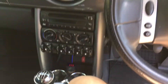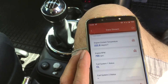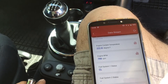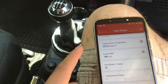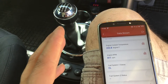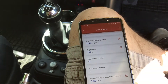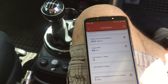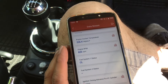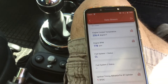220°F corresponds to about 100°C, and that's actually the most important thing I want to show you in this video, because these R50 Minis do suffer from coolant issues. Some of you might be watching just to see what a normal coolant temperature looks like. On these R50 Minis - and the newer ones as well - 100°C is not unusual, because the thermostats are designed to start opening at 92°C and fully open at 103°C. So around 100°C, especially on a warm day, is not unusual.